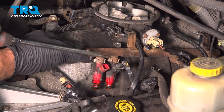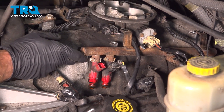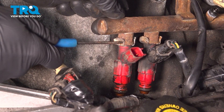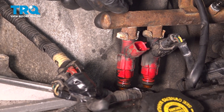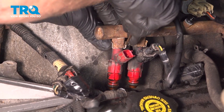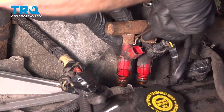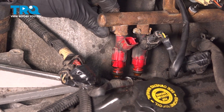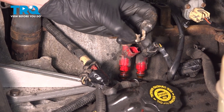Since I'm only replacing this one right here, I'm going to continue with this point. If you are replacing all of them, go ahead and lift up the rearward injectors as well. Now we can pay attention to where the fuel injector connects into the fuel rail. In this area, you'll find a metal clamp that makes its way all the way around the backside. To get this out of place, you can use a small screwdriver or a small pick. Be careful not to drop it. Give the locking clip a close inspection to make sure it is still reusable, and set that aside.